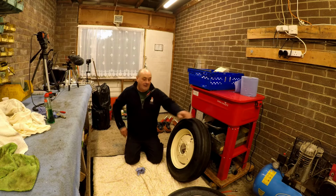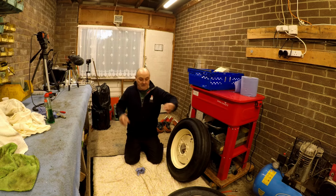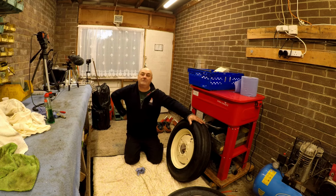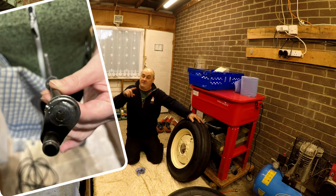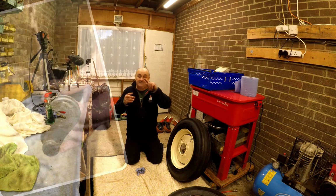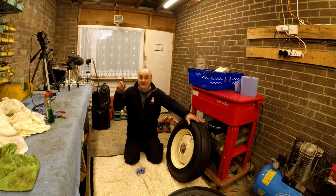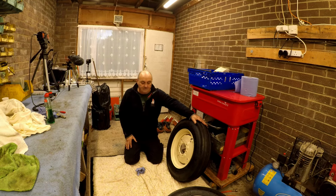Right, in the previous video, well, we fixed up that spare selector body. The rod that controls the fork, the bit that you actually turn on the outside, goes down, makes the fork move back and forward. If you have a look at this picture here, if you remember, and I'll put a link to the video here, go back and watch a video of me taking this to pieces. This was broken when I opened it up, it was snapped off. However, when I took it to bits, you could put it back together and you could rotate the two parts, and there was a position, and you'll see it in this photograph, where the two fitted together and the bit of broken weld fitted in the hole perfectly, which was as in this picture at 7 o'clock, right? Handle up, crank down here at like 7 o'clock on the clock face.